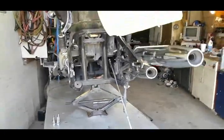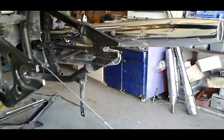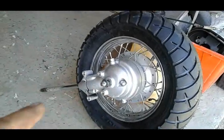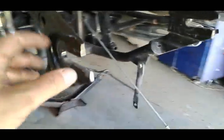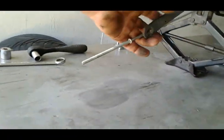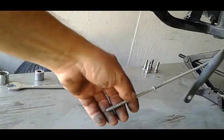It was kind of an afterthought to do this video. If you're doing this at home yourself, the wheel on the V-Star 650 or 1100 comes out a different way than most bikes — it actually comes out complete with the drive shaft. What you do is just loosen up the axle, you don't take it out, and there are four bolts over here that you need to take off, and of course undo your rear brake drum holder and the shaft for the lever.